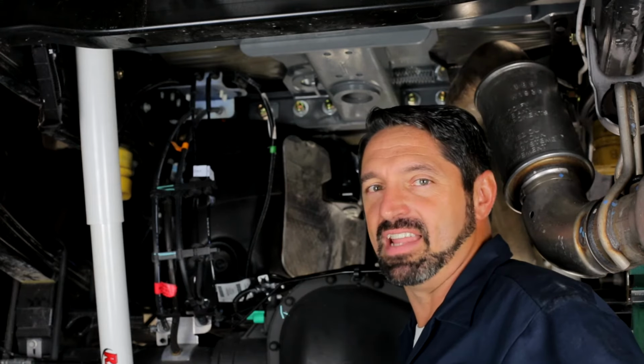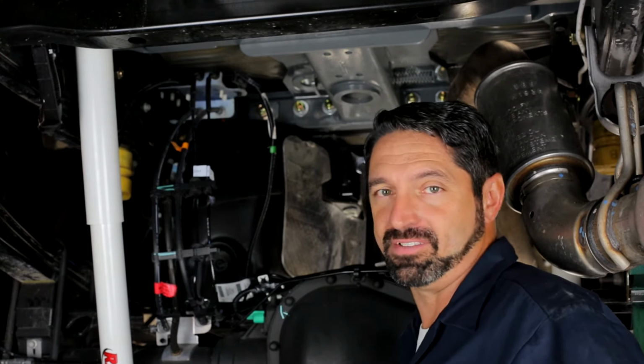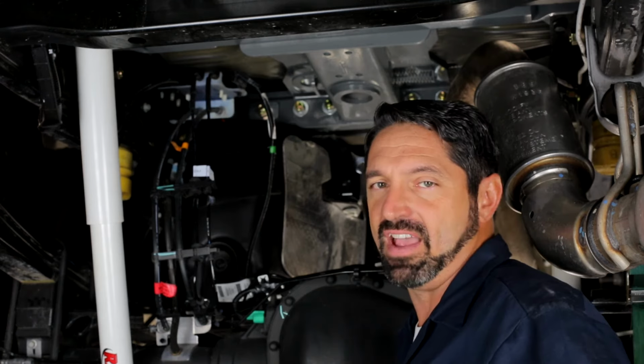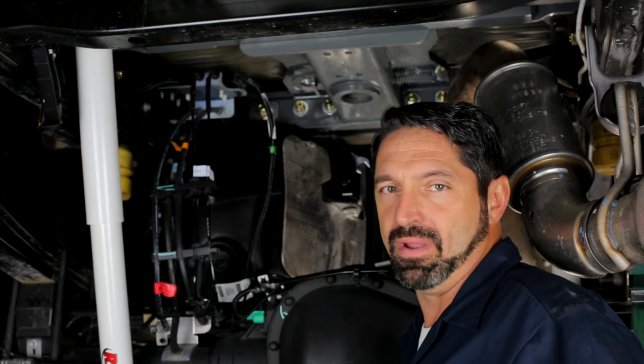After following the proper tightening sequence and everything's tightened down, you need to torque all the fasteners. Be sure to torque the 1/2-inch fasteners to 100 foot-pounds and all of the larger 5/8 fasteners to 150 foot-pounds.